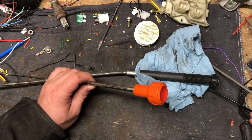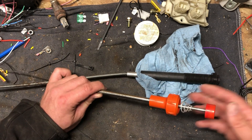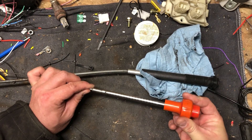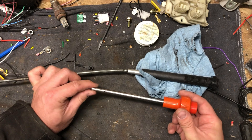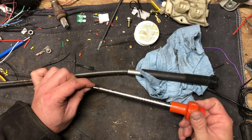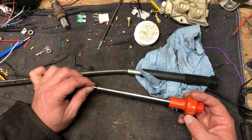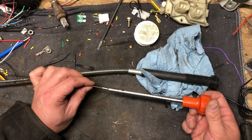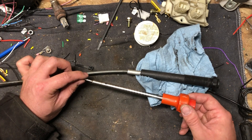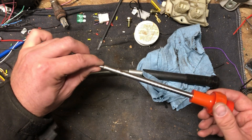So the way this works — I should back up for a second. On airplanes, unlike cars where you just got a throttle, you can also — because you're changing altitude and whatnot, and they're fully mechanical, there's no electronics affecting how the fuel mixture is. Everything's fully mechanical, so you need to be able to adjust the mixture to change that 14 to 1 fuel-air ratio as you go up and down. So that's what this control is doing.